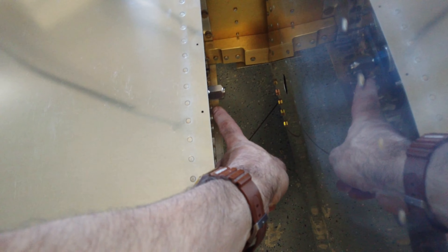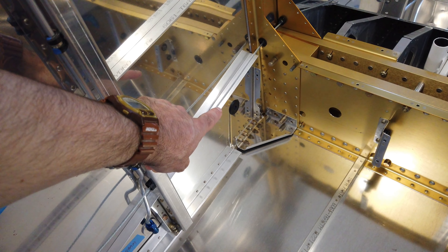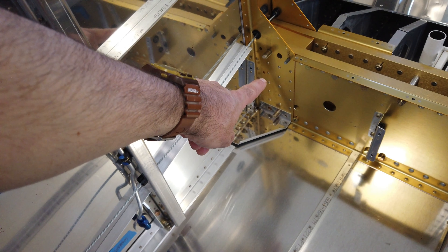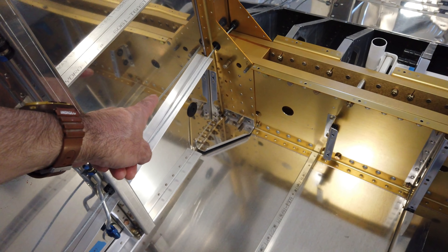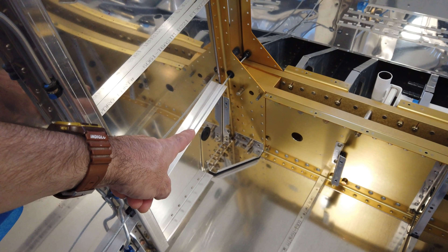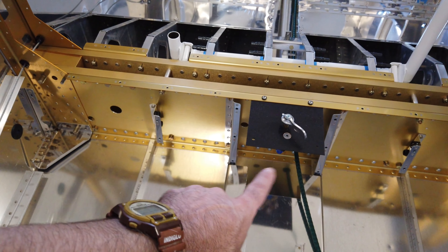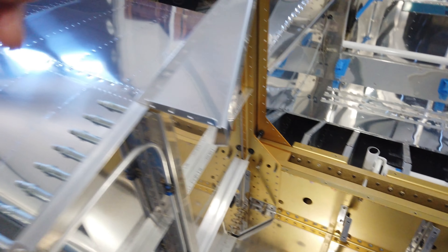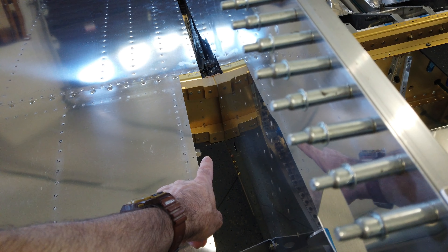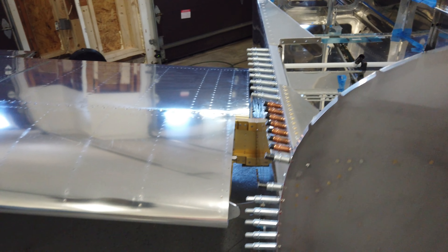What's important is I've got a dimension now from the side of the fuselage over to this fitting on the wing. I've got a measurement from where the line comes through the side of the fuselage, then there's a 90-degree bend to go back toward the spar, and another 90-degree bend to come out this way and feed through this bracket. I kept the s-bends and the length of line so I'll be able to duplicate that when I redo it. My battery is getting ready to die so I'm going to wrap this up.